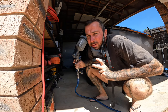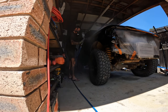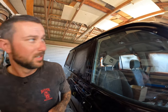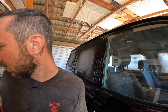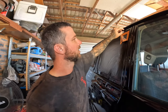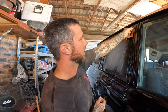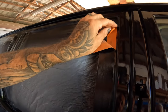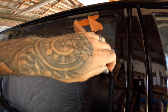Make sure you wear a paint mask with 2K — it's apparently not too good for you. I'm just pulling my tape off now. It's been about 15 minutes since I did my last coat. After about 15 to 20 minutes, start pulling your tape back just so it doesn't create a full chemical seal between the two — otherwise you'll get a line. It's coming off easy, not pulling the paint, which is the best bit.